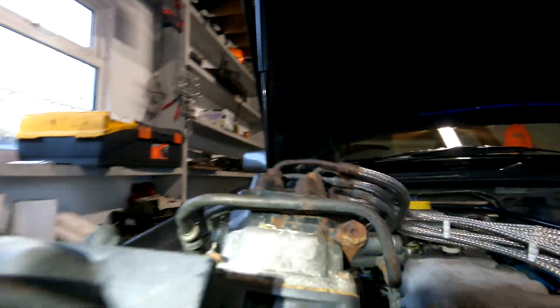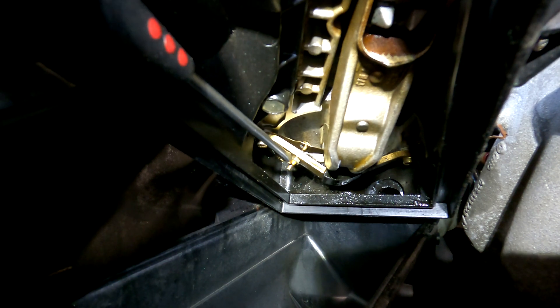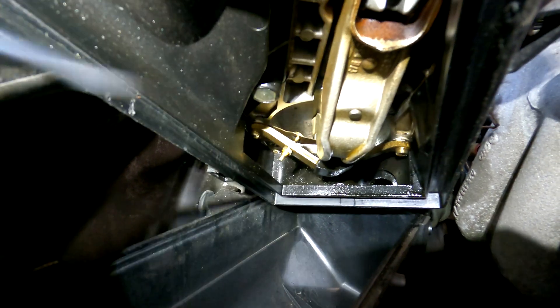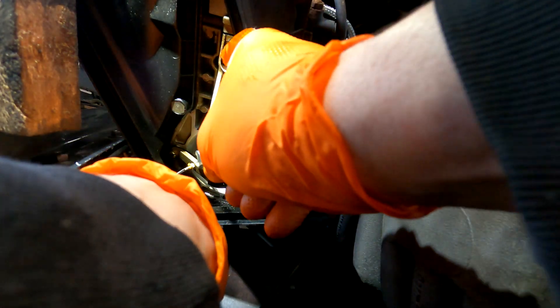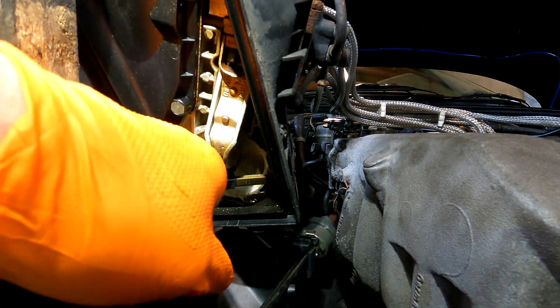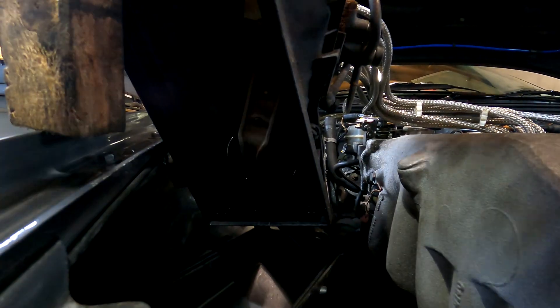After removing the clips, you have this view. That's the adjustment - use a really small spanner and gently screw it. That's the bottom of your flap, so don't go too much. Very small moves, very tiny adjustments. I try to measure now - I'm nearly there but I'll still lift it up a small bit. I hope that will give it more air.